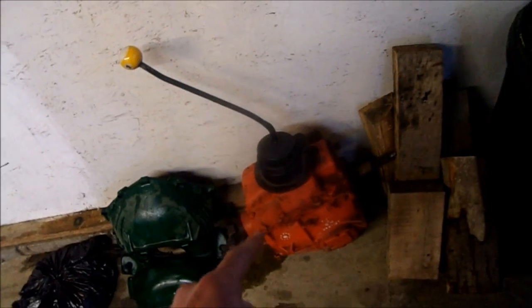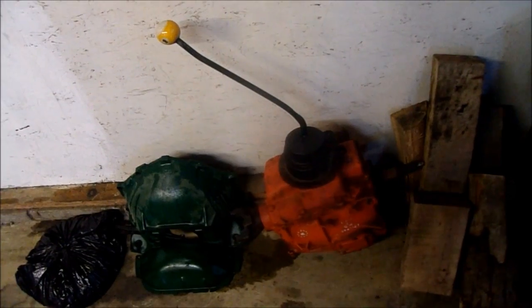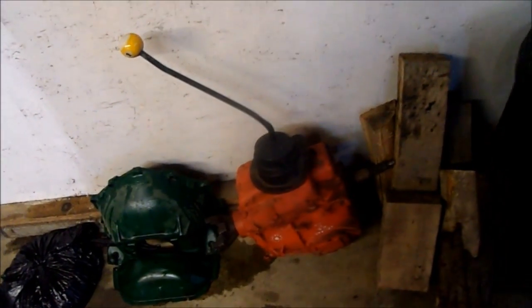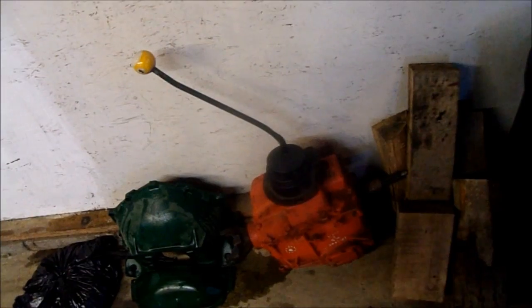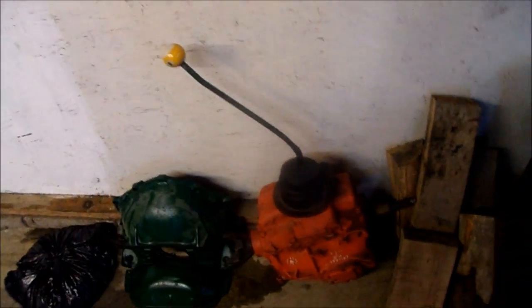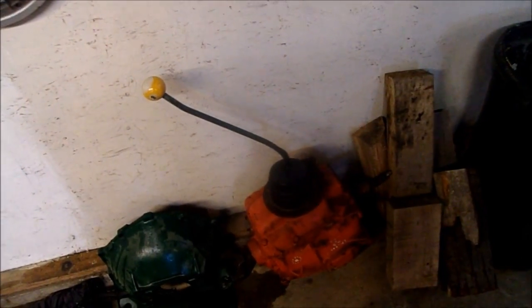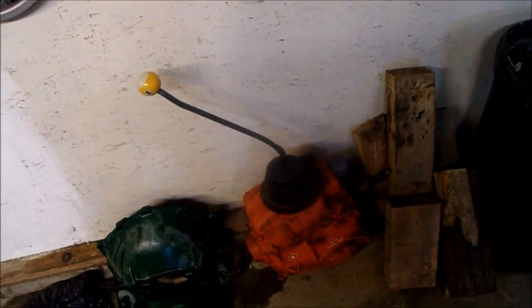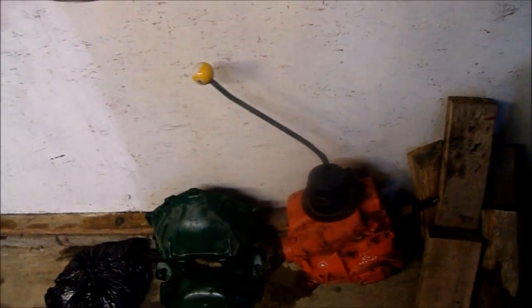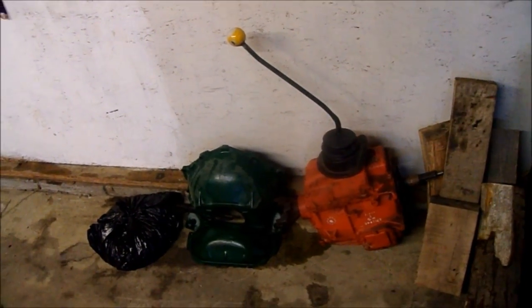I don't want to use this transmission. I don't like it. This is the original one. It's got the granny low, the big space between third and fourth. I don't like that. It's just not a performance transmission. It's not really good for on the road. It's a good four-wheeler, off-roading kind of deal, but I don't like it. I like to drive my truck, and this thing just isn't that practical. So I'd like to get a Saginaw 4-speed or a Muncie M22 or something like that.